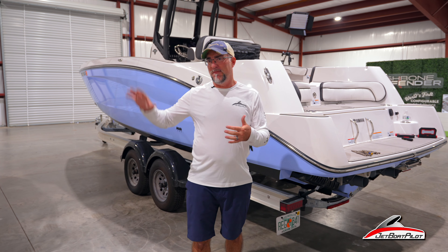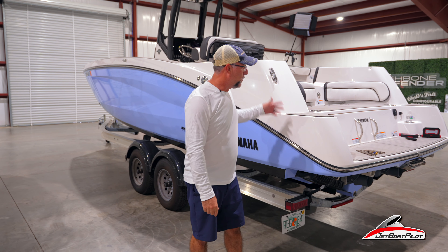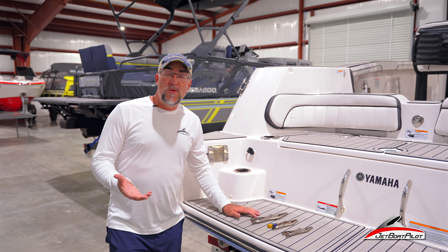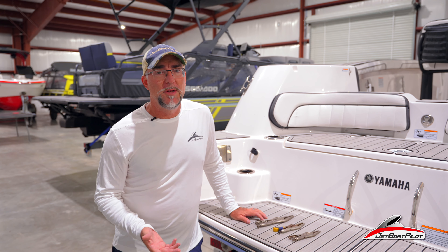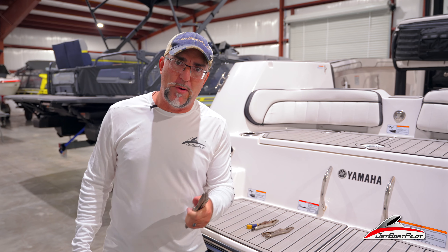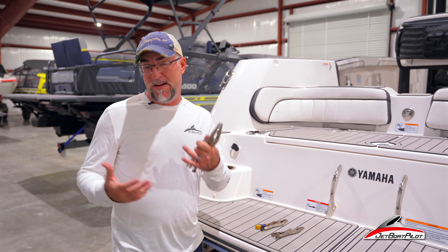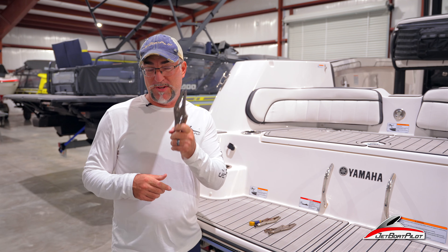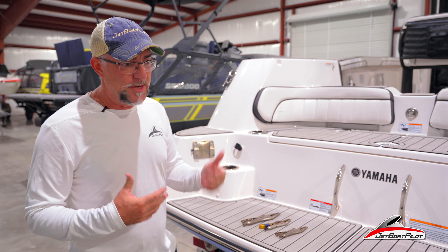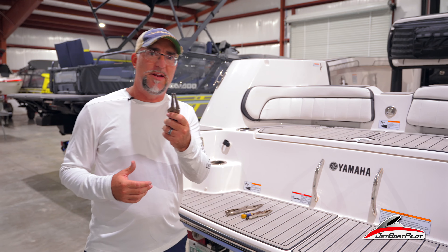You do not want to tow any faster than five miles an hour if you've not clamped off this line. I'm going to show you in this video how to clamp off the line on the Sea-Doo, as well as on the Yamaha — both a supercharged as well as a naturally aspirated version. Let's jump into it. So depending on if you have a single engine boat or a twin engine boat, it's going to require either one, two, or even three pairs of vice grip pliers that you keep on the boat at all times.